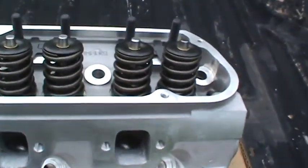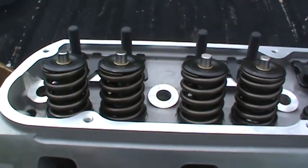As you can see from the ported numbers, at 600 lift there's quite a bit more power left on the table as far as airflow is concerned. That's showing me this engine combo could benefit from lifting the valves a little higher - I could possibly pick up maybe 20-30 horsepower by going to 550 lift or greater. But everything in life including horsepower is a compromise - I may lose some drivability, I'll for sure lose some MPG, and I may have to switch to a higher spring rate. These springs are only rated at 550 lift, with seat pressure of 130 and open pressure of 330.